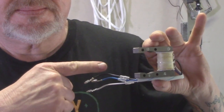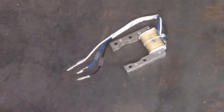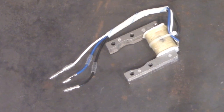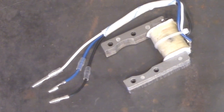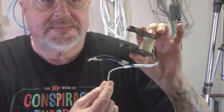If you're going to ride a motorized bike, you need a spare magneto coil. Some people call it the coil, some call it the loop, some erroneously call it the magneto — whatever you want to call it, get one. These go out early and often. If you've got a no-spark condition, this is the first thing to check. The white wire on it — cut it off and throw it away. It robs power from your spark. You don't want that.